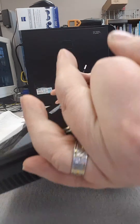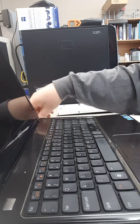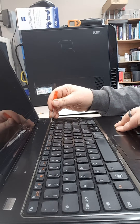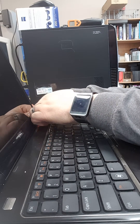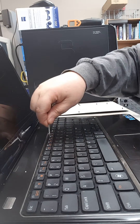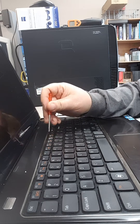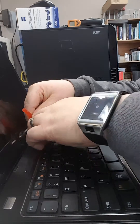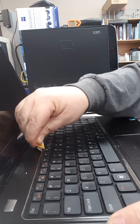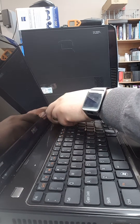Now that we have that done, we need to flip it back over and open it back up. We'll have to remove the keyboard. For that I have a really small flat blade screwdriver — you can also use an opening tool. There are little notches here that you press in and then lift the keyboard up. Once I get it up I'll leave my tool under there. It's not always ideal to use metal tools on plastic, but we'll continue. You can also slide the tool along to get all the clips loose.